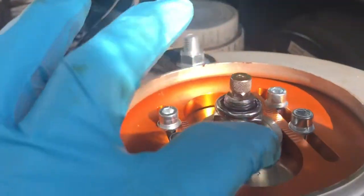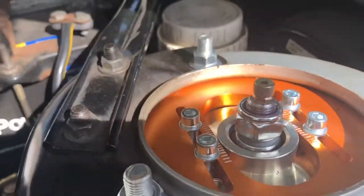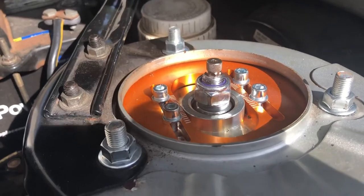Pretty much I'm just going to take these bolts out so this can move around, and I'm going to try to grease this top pillow ball mount under there while I move the coilover and see if that helps at all. Here we go.